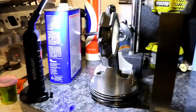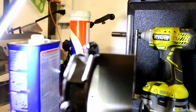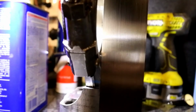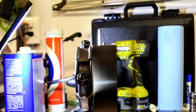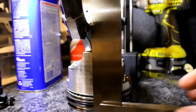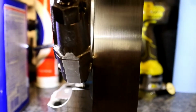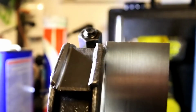And to verify it, when I took it out, I came over here with the machinist square, and on the top, it's touching. And the bottom side, there's a little gap there, if you can see that. So this face here, where the connecting rod meets the other connecting rod, should be 90 degrees perpendicular to the piston or the cylinder wall. It's certainly not. I could measure that with some feeler gauges and see what it is, but there's the gap right there. And up top, no gap.